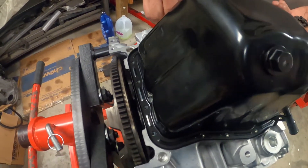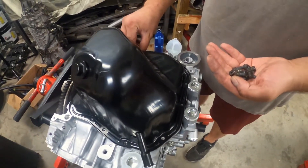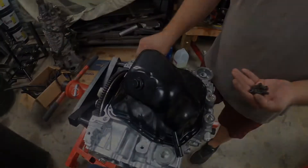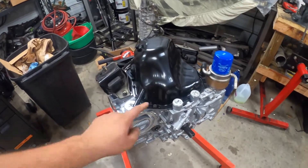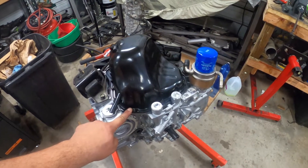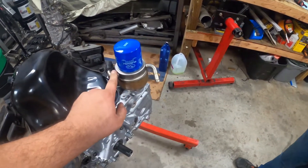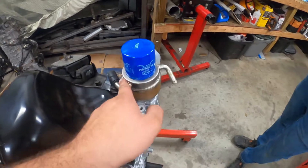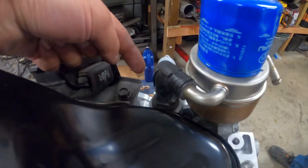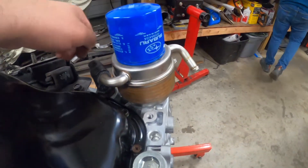You can go around in a circle on this one too — there are quite a few bolts. We torqued down the bolts on the oil pump and spared you the details. Then we put the oil cooler on — this is not applicable to all cars; some early Foresters didn't come with this but STIs and a lot of other cars did. This one gets a 90 degree elbow with some heat shields for the hose. Then we put a fresh oil filter on.